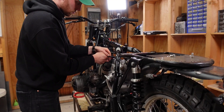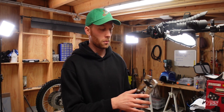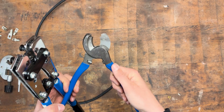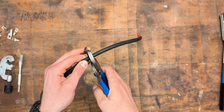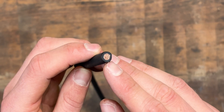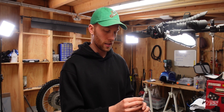Once you know which terminals you need and how the routing has to be, you can go ahead and cut the wire to length, but leave a little bit of slack. First do the terminal that goes onto the bike, then route the wire and exactly determine where you need to do the second cut for the second terminal. The crimping pliers often come in a set with a wire cutter for big wires like these — they make a very precise cut, so it's actually quite a nice deal to get that one as well.